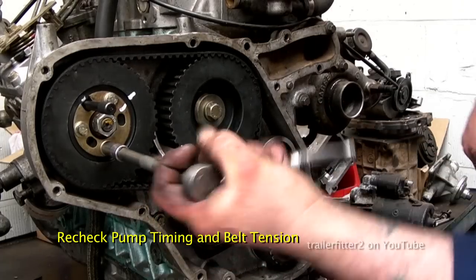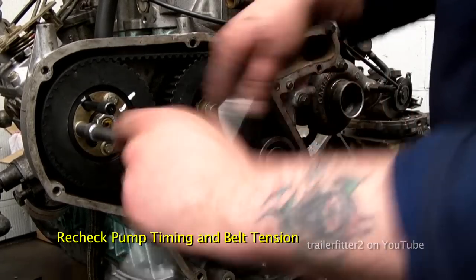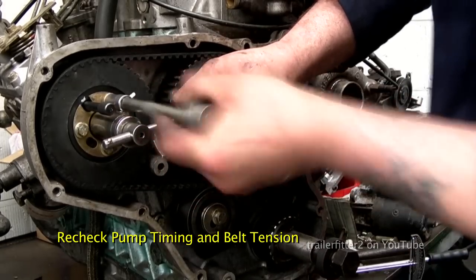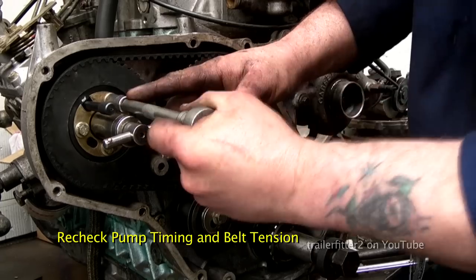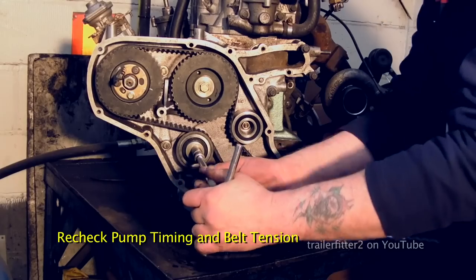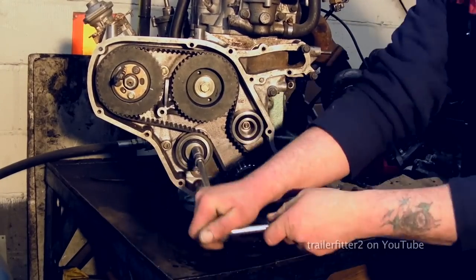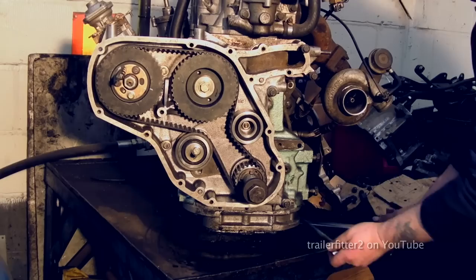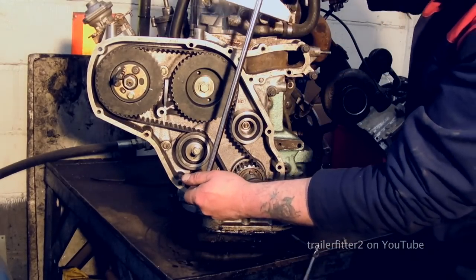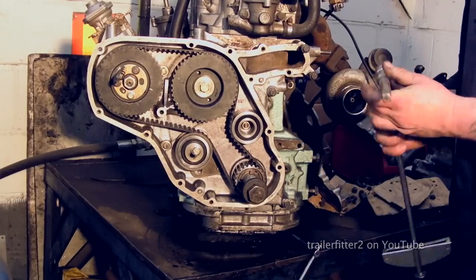Okay, making sure that the crankshaft's correct, the camshaft marker is right, and you have the timing pin back in for the fuel pump. Undo the three bolts which lock the locking plate. The second thing you need to do is to readjust the tension on the idler. This is important. Once you set it right, then that should be alright for the next 5 years or 100,000 miles, depending what you need.